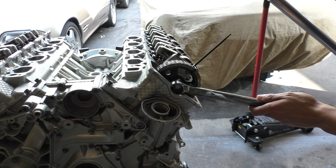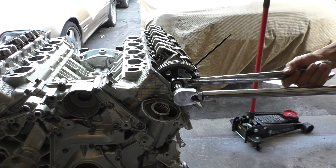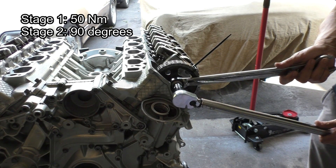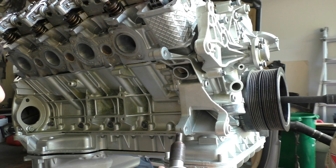After that I got to torquing down the bolts for my camshaft sprocket. You need to hold the camshaft sprocket with a 27mm spanner and then torque this bolt down in two stages: the first stage is 50 newton meters and the second stage is 90 degrees.